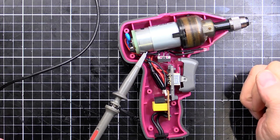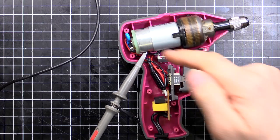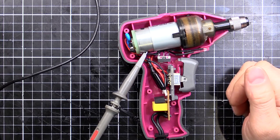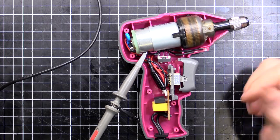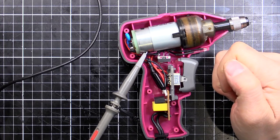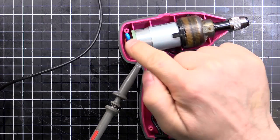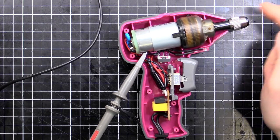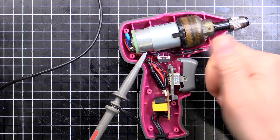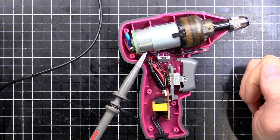That's all we can really do with this little thing without that earth, or without changing the motor to an AC brushless motor — there's not much we can do about the noise. We've got to put it somewhere, and at the moment it's just radiating off that case. The residual stuff that I showed you on the scope, that's going to come out through here if we connect those caps up and ground out through whoever's touching the end of this. So I'm going to say it's half fixed. We'll see you next time.